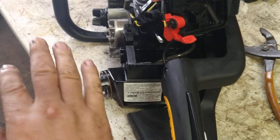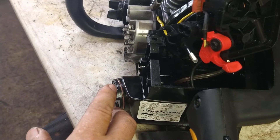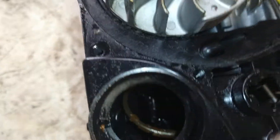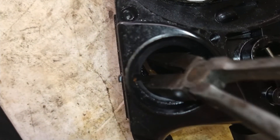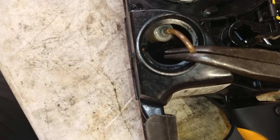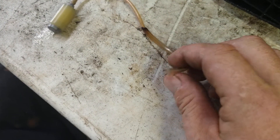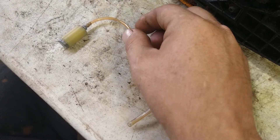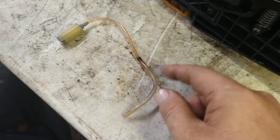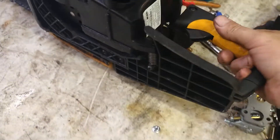Now we're going to go ahead and open this tank out. Make sure all the gas is out of the tank and it's clean. We're going to pull this line through - reach right in there and grab it. It's got the fuel filter on it. You can use a pair of needle nose to reach in there, or even a bent clothes hanger straightened out and bent into a hook - just reach in there and grab it and pull it out. As you can see, this fuel line is disintegrating; the inner is separating from the outer. What happens is even if the outer stays intact, when the inner separates you can't even see it and it starts collapsing inside itself, stopping the flow of fuel. So it's always very important that you change the fuel lines out every time.